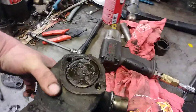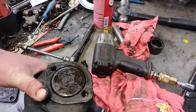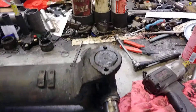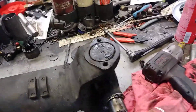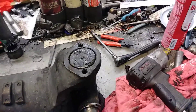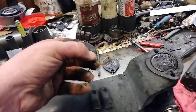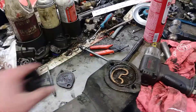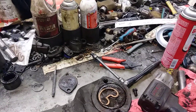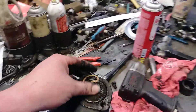That yoke is worn slap out. On your vehicle shafts, pull it out and change your u-joint — just grab hold of the journal and turn. You can look on your vehicle; you've got snap rings like this right here. You can turn it and watch the cap underneath the snap ring — if it's sitting there and turns, that means your yoke is worn out.